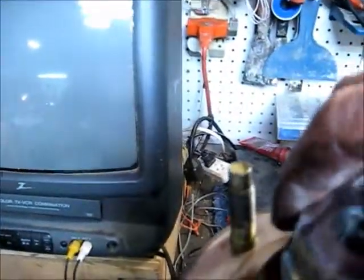Now what I'm going to try and do, I already lubed up this hole with a little Vaseline, but this is going to have to go on here just like that. And then you're going to find yourself a good socket, like this one's about 1 1/4 inches. Get that all straight and just take it easy and tap it down.